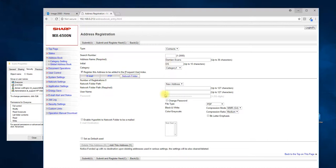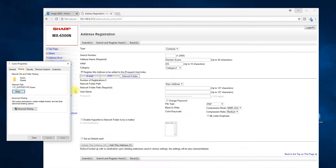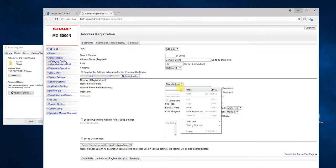After we're happy with this, drop down to the second half of the page. Under Network Folder Path, this is listed as a new address. For the Network Folder Path required field, we're going to grab the information from our scan destination folder that we created. On the sharing tab, when I shared that folder, it created a network path. The easy thing to do is just copy that path and paste it directly into the Network Folder Path field here. This will point directly to the computer and the folder called Scans.